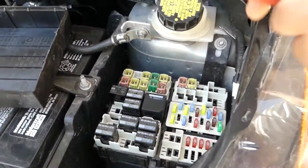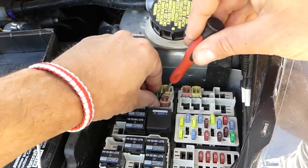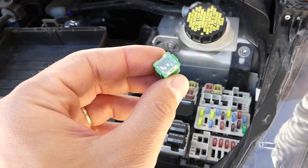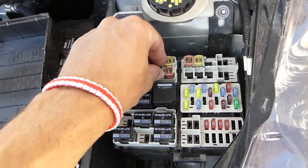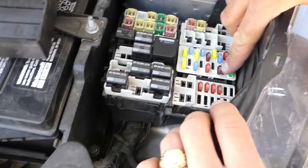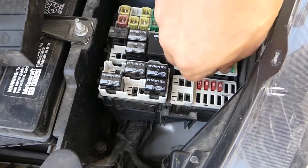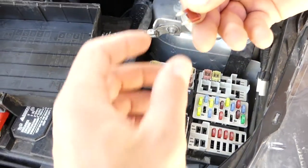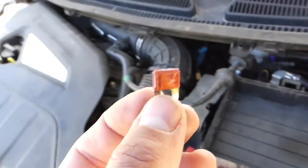It's a little bit tight — just pull it out right here. This is one of the fuses. The other fuse is number 32; ours is 7.5 amps. Pull this one out as well. You can check them against the light to see if they're burnt on the inside.